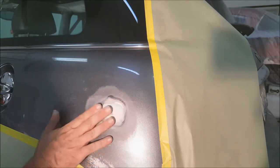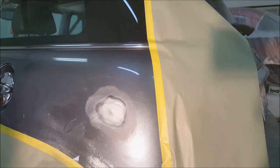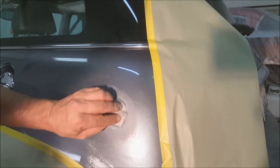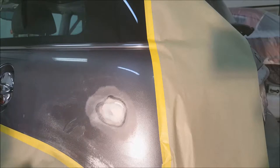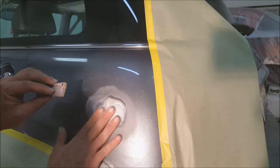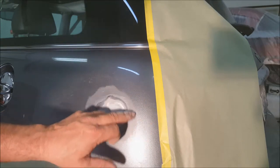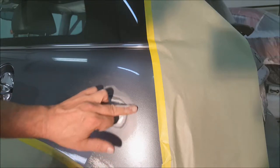This is pretty close now. If you're going to use spray can primer, you'd want to stop at this point, use some 320 to finish it up — that'll help with the shrinkage later on because the finer scratches won't show nearly as much. If you're using spray can primer, you also definitely want to feather this out a little better with 320 before you prime.